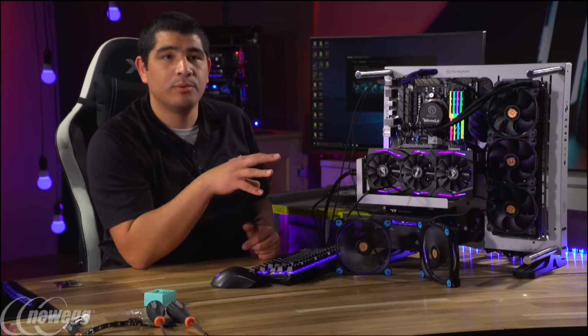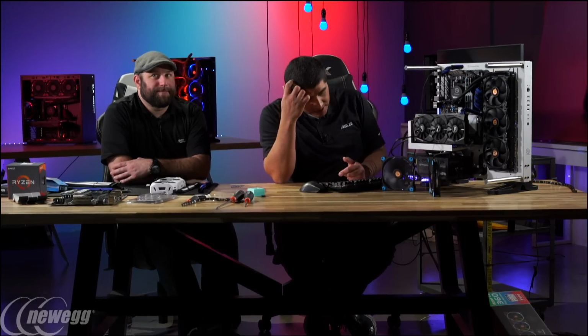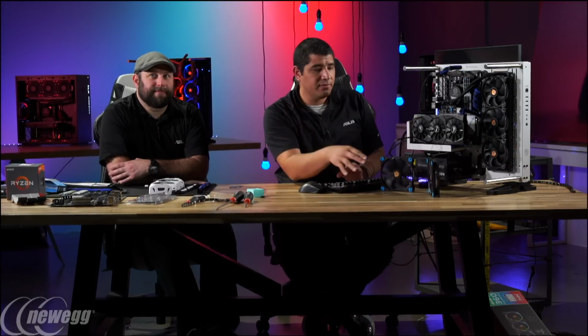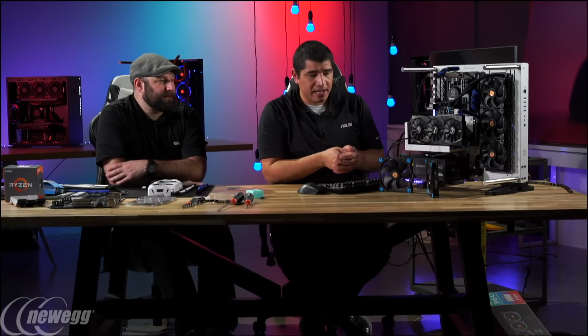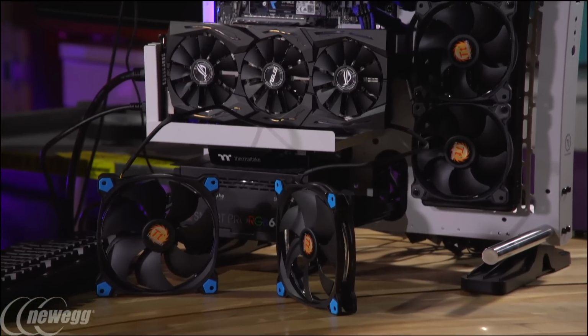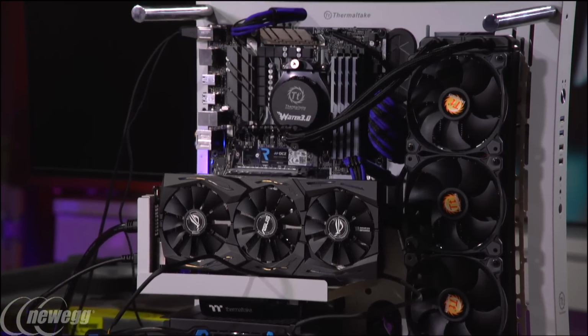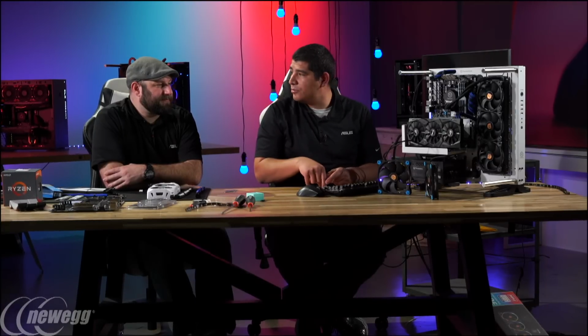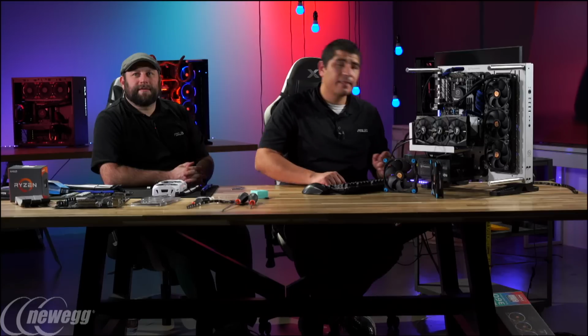And the reason why this is important is because historically, when you used to run a fan speed option in the BIOS, it might say silent or standard or something along those lines, but it wouldn't necessarily be representative of what the system is truly capable of, right? So when we store all these values, the cool part is that we find what the minimum and the maximum are for the fans, so that when you go into the preset options, you have the ability to click silent and the actual fans will turn off, versus just going to an approximate silent speed. Or you can tune up to a higher level. Yeah, and for people who haven't built a PC in a while, this is not a small thing.